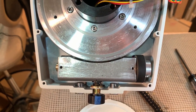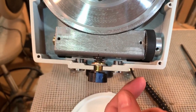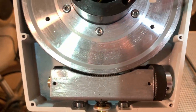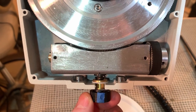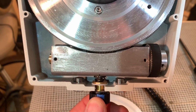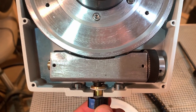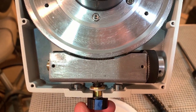It sounds pretty smooth. So the way that you would then disengage this gear is you turn it clockwise. The blue tape here indicates just so we can see how many times I'm turning it. This is fully engaged. This is backed off about a quarter turn. If I turn it all the way around one time, you don't see any movement yet in the gap.